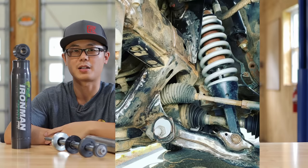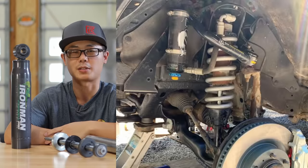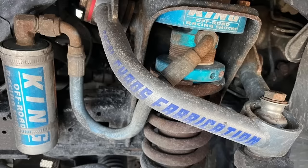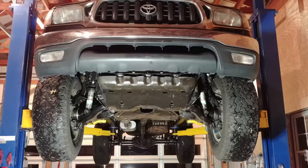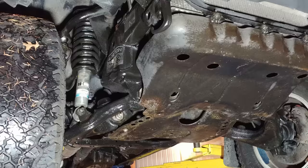I have seen many of my friends' high-end racing shocks rust out in just one winter. So if you have a zinc-plated shock body, make sure you wash your car very often and re-apply oil-based rust inhibitor multiple times throughout the winter.